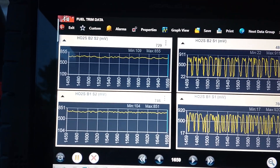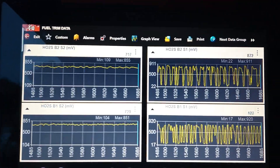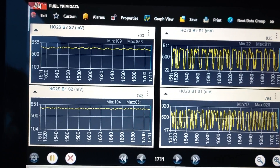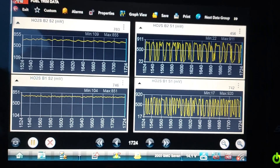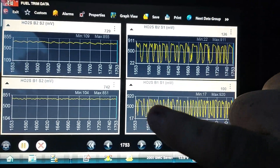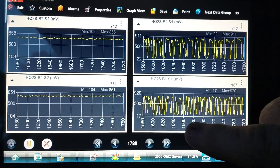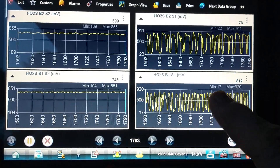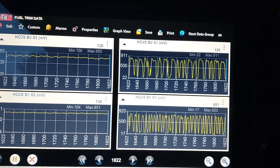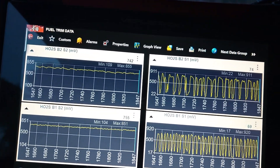You're looking at basically a one-volt range, and sometimes you can go a little over one volt in certain scenarios. The computer reads the air-fuel ratio through the oxygen sensor — the sensor creates its own voltage and feeds it back into the ECM, which then adjusts the air-fuel ratio rich or lean to make the line go above and below that 500 millivolt line. The term you may see is stoichiometric — that's the theoretical cleanest burn you can get. It needs to cycle on purpose; keeping it at the center line would hurt emissions.